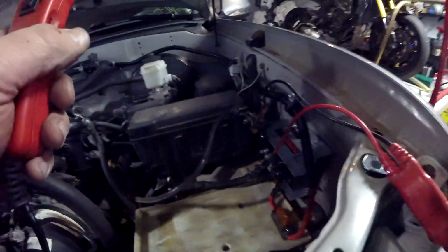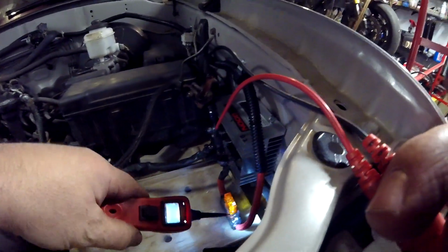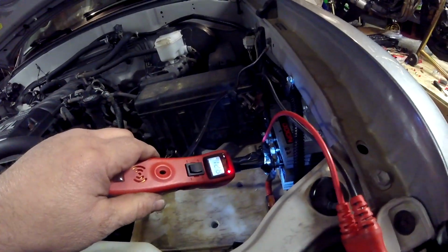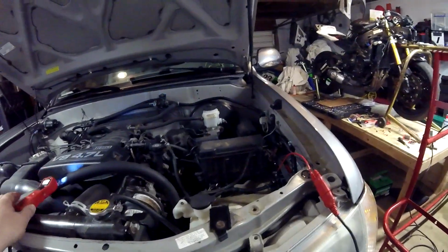Okay. So until that coil is energized with 12 volts, these two terminals aren't charging. So how much voltage do we have in the back minus the voltage drop? We got 12.7. I'm surprised to see that much. I was expecting 12.4 or 12.2 because I've been running lights off of those two batteries for a while. I charged the cell phone off of those two batteries twice for about a half hour apiece, and then I also plugged in lights for like 2 hours, and we're still sitting at 12.6, 12.7. And that's after the voltage loss of the circuit. So those batteries are still brand new and fresh and not run down yet at all, hardly. They're in good shape.